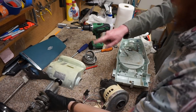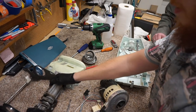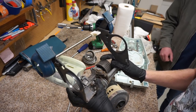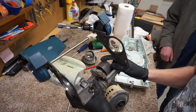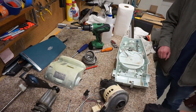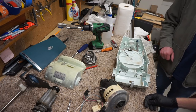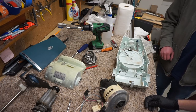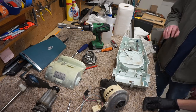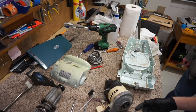Despite it looking way different, the way this machine's handle mechanism moved is the same as the Hoover for the Tacony machine. It's very similar to the Hoover Wind Tunnel. They did not go with the same floating nozzle design though. I think the floating nozzle design was actually one of the pluses of the Hoover Wind Tunnel. I think it really helped it make good contact with the carpet, although it did enable it to chatter when you go against carpet with a very stiff grain to it.